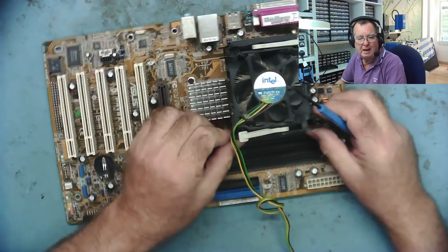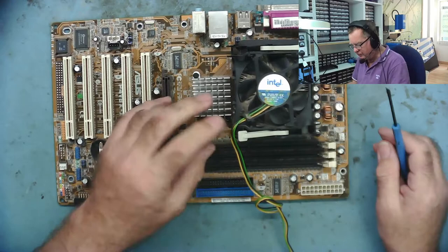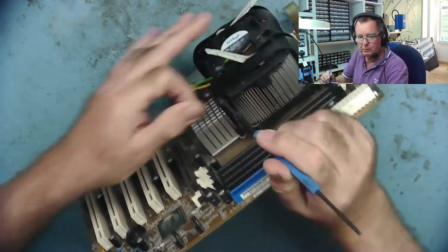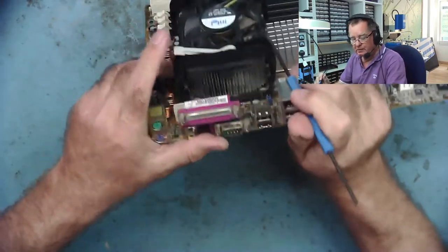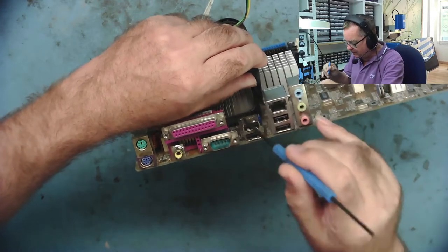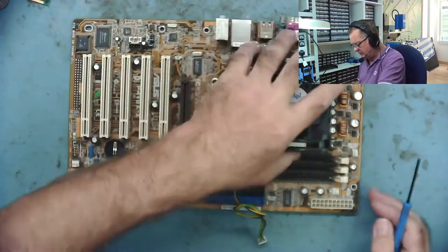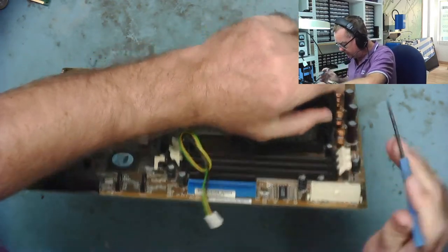You need to be aware of this, because if you don't lift it off straight, you've got a very good chance of actually bending pins on the CPU — possibly even breaking them, or damaging the socket, and this is not what you want. So the way to remove these is to use a little crowbar, just lever it inside there to release the clips — same on the other side, push outwards a little bit, a little crowbar in there, that's released that one.